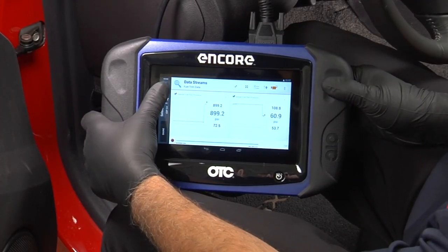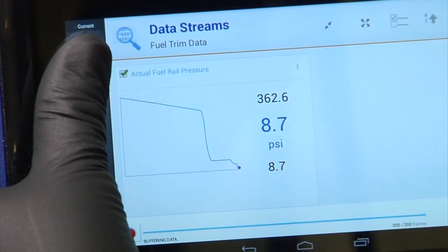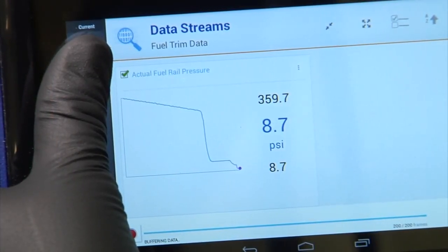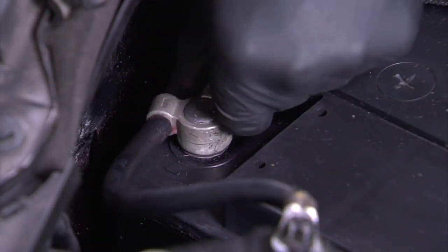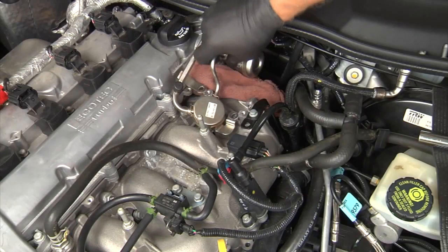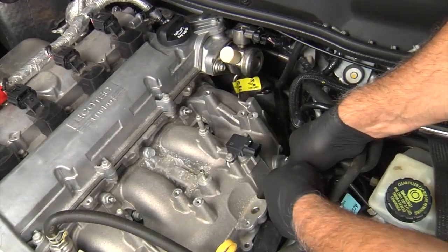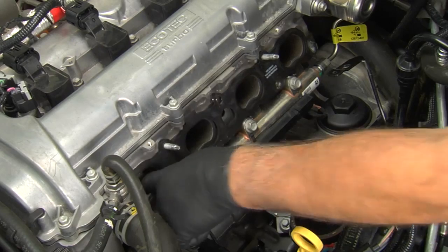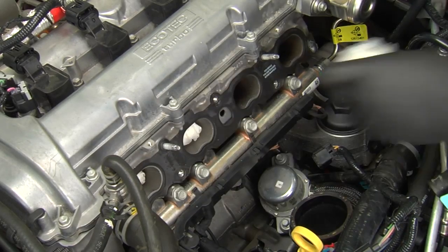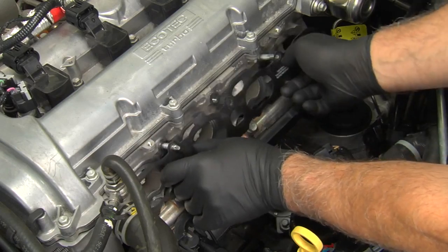All Bosch tools for your application can be found on our website at bosch4gdi.com. Safely relieve the fuel pressure according to your vehicle manufacturer's recommended procedures. The high pressure should be monitored with a scan tool to verify that high pressure is no longer in the rail. Begin replacement of the fuel injector by removing the negative battery cable. You should also remove any necessary components to access the high pressure system.